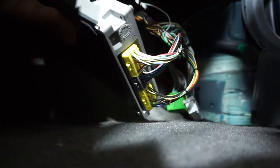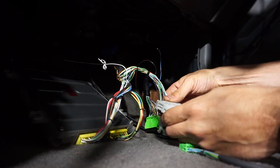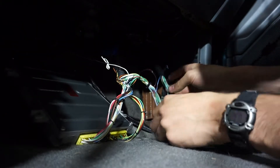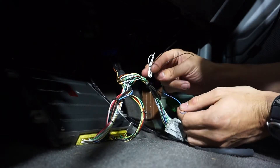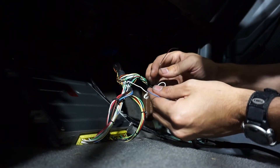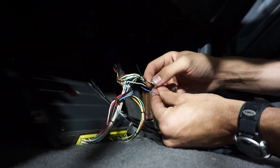It's literally that easy for those plugs. For connecting these two plugs, you're going to need that sub harness I was talking about earlier — just match the gray one to the gray one and the green one to the green one. You might notice I've got a couple spare wires here. These are optional for some people. One of them is for the AC compressor clutch, which I'm not using. One is for the AC switch on the dash, which I'm also not using. And one is for an O2 sensor, and I'm using a wideband, so I'm not using that one either. You could tape these off, or you can find the pinout online for a regular P28 ECU and they'll tell you exactly where to splice these in.